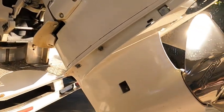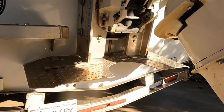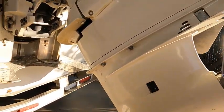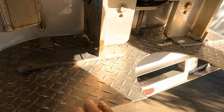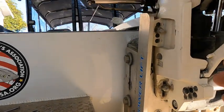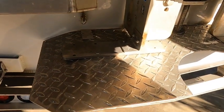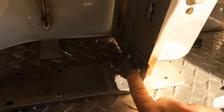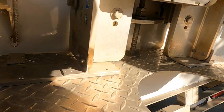Okay gang, we're into February now and I'm going to go ahead and change my prop out and put my jet back on. First thing I have to do is take the splash guard off that I put on when I had the prop on, so when I put it in reverse I don't shoot a ton of water up over the top of my transom. I'm going to go ahead and pick out these four bolts on each side and get that done.